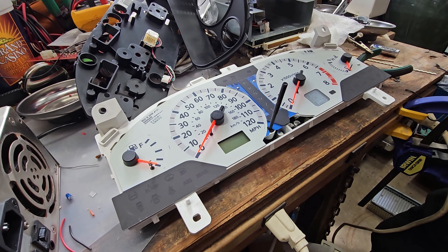Take the big needle - you'll see a hole in the bottom of the needle and a shaft sticking up out of the motor. Gently place this over the top and keep it lined up with our mark on our tape, then press down. That looks good - it's right on our mark. Press down just a little bit, not too much. We don't want to sandwich it so there's drag - it moves nice and free. Do that same process with the rest of the needles.